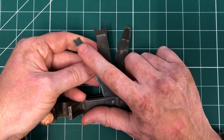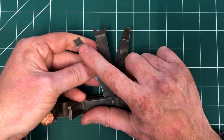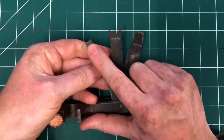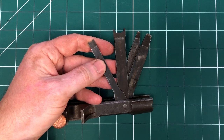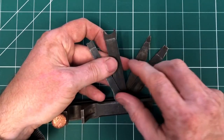When cleaning the piston, the fouling collected on the diameter and in the annular grooves should be removed by means of a wire brush or scratch card. The grooves are finally cleaned by inserting the smaller of the forked screwdrivers and rotating the piston. So there's a cleaning purpose there as well.